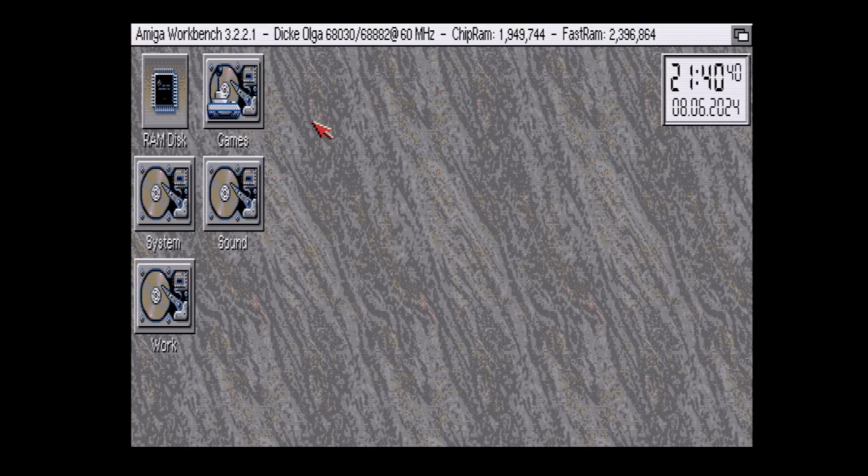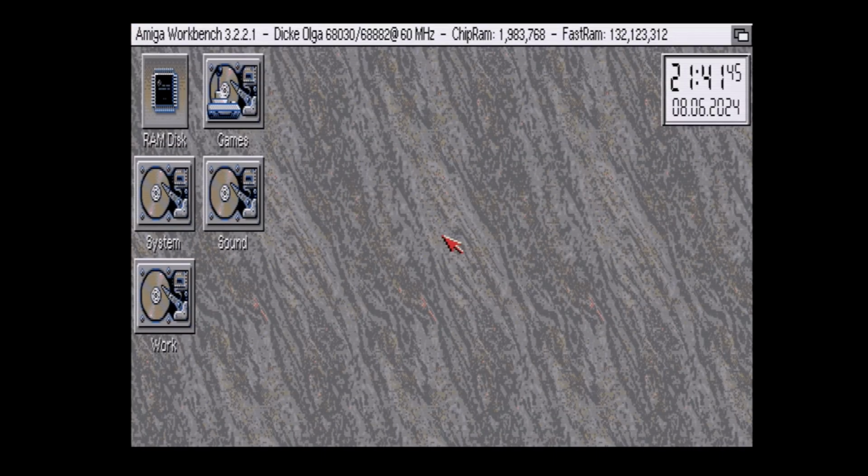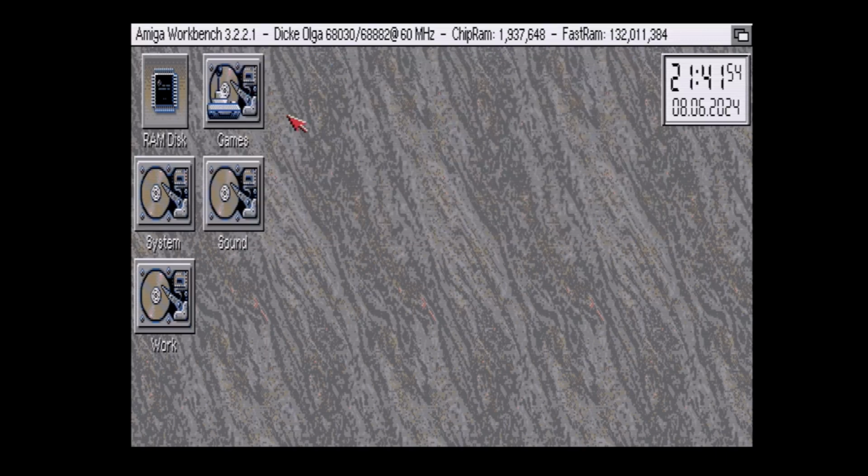I'm going to go back to the full version of the card, and I will join you at that time. Okay, 68000 mode is now disabled. Now we're going back to the full 68030 goodness. Just to let you know, if you're going to use the 68000 fallback, do that when the computer is off. If you try to flip that when it's on, it's just going to lock the computer up. I don't think it's going to hurt anything, but even with the auto boot, best idea is to have the computer shut off completely and toggle the switches, and then away you go. So yeah, there we go. We're back to the much better version of the card, unleashing its full potential.